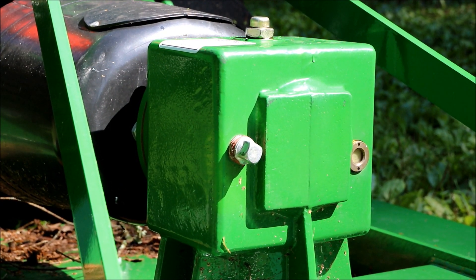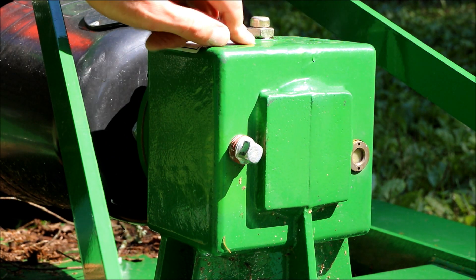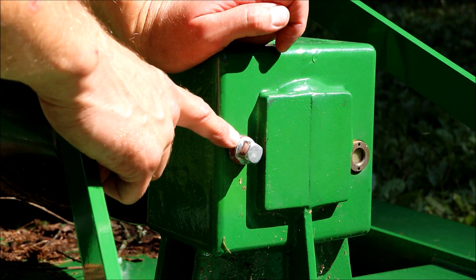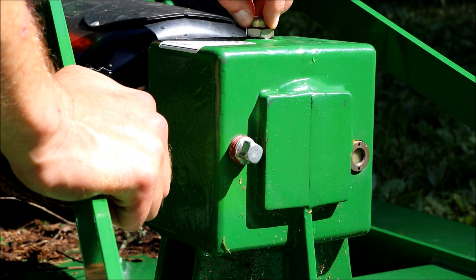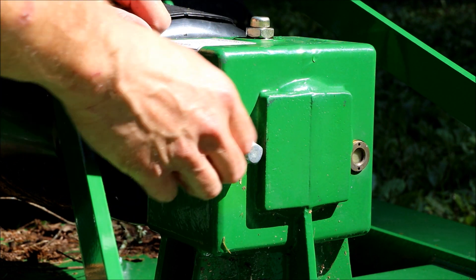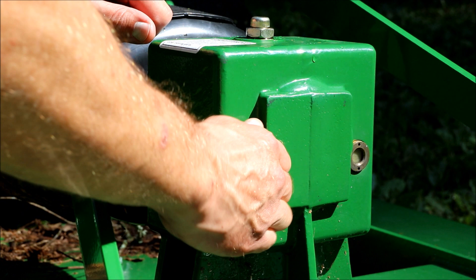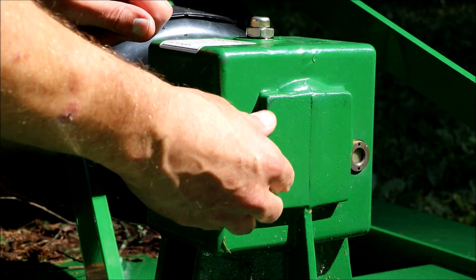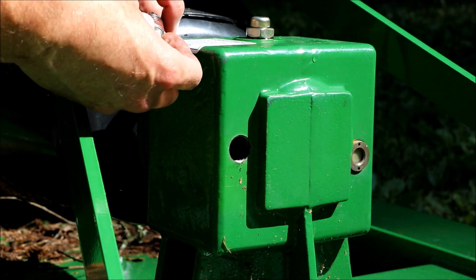I got this loose here. I did take out the top and it doesn't appear that there's any sealant — it's got this red that almost looks like a thread seal or Loctite on it. The top breather here doesn't have anything on the thread, so maybe the water is sneaking past the threads a little bit. It looked like the oil was over the gears in there, but it didn't look like there was water — though it looks pretty creamy in here.